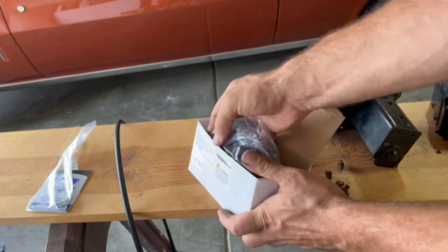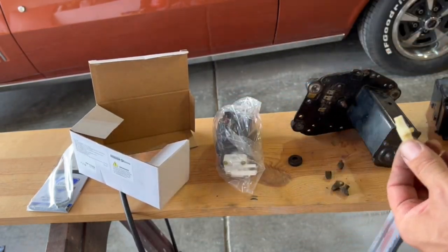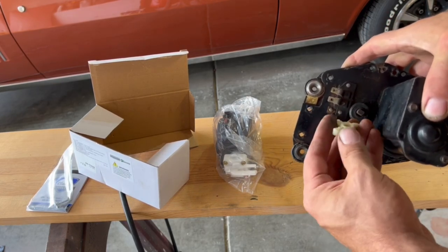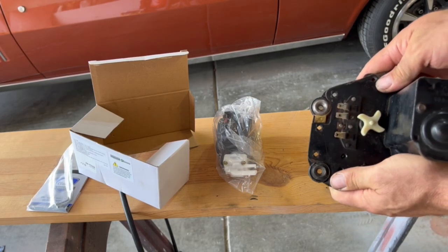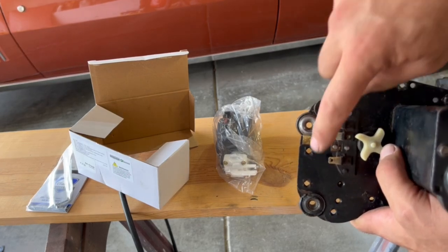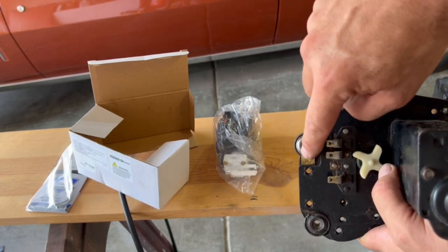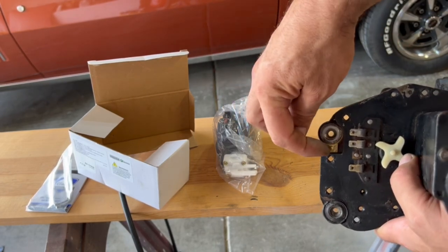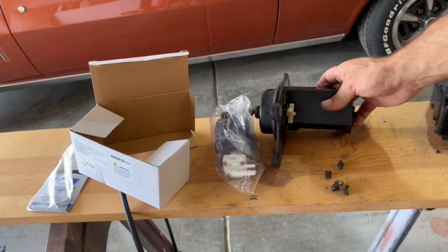Here's the new cam — that's what it should look like. It rests on here with a little rubber seal. Now, here's the important thing about mounting: there are three bolts to the firewall — one, two, three. This is our ground bolt, so make sure this one is really clean. That way when you put the bolt in, it grounds up through the bolt to the firewall. This is the ground for the motor — make sure it's good and clean before you put it back together.